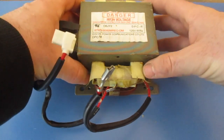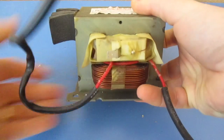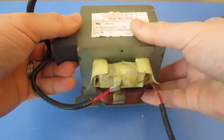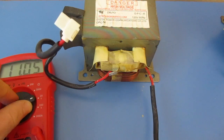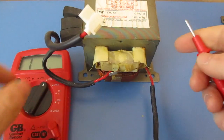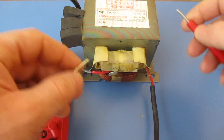Last, what we're going to do is test the high voltage — that's that little bit finer wire. It's usually here on the top, you can see that lead coming directly out of that winding. To test this one, we're going to set our multimeter to the 200 ohm range, and I should get a reading somewhere between 80 and 120 — somewhere in that range.